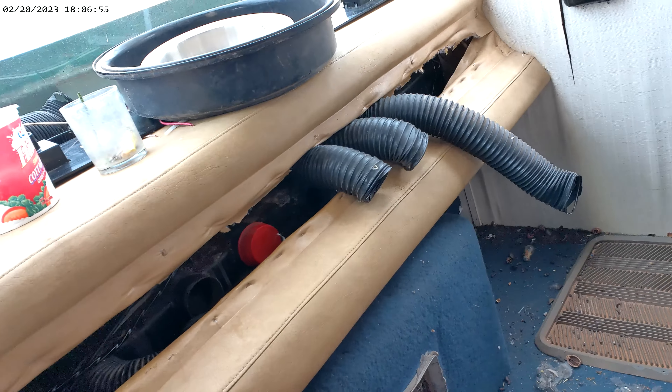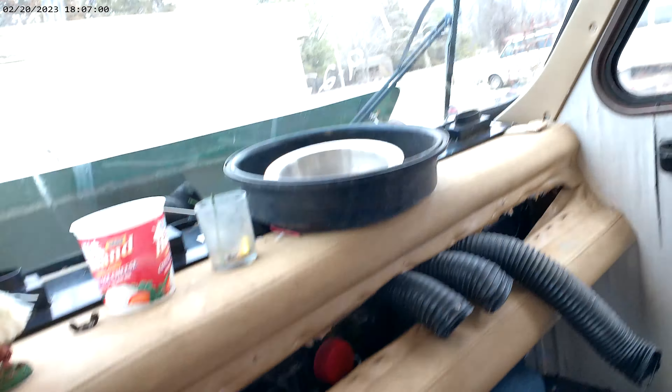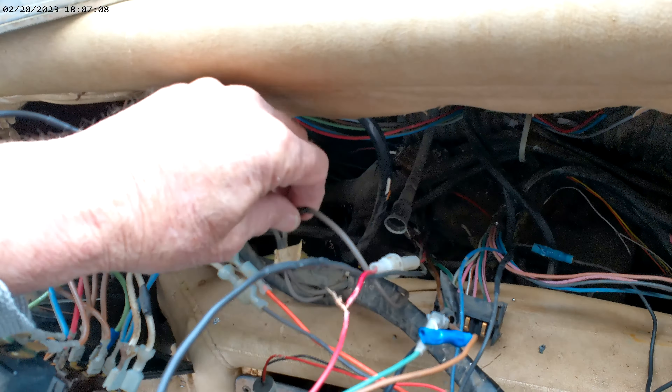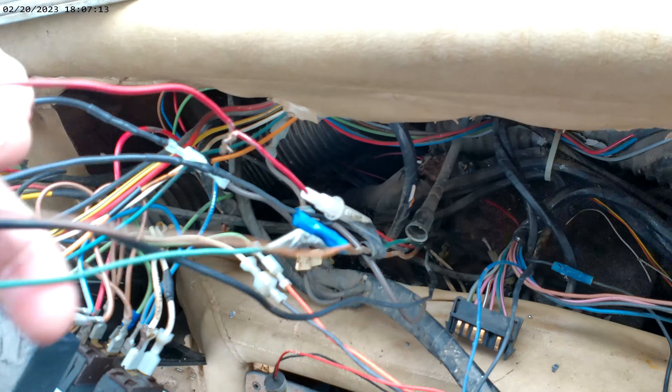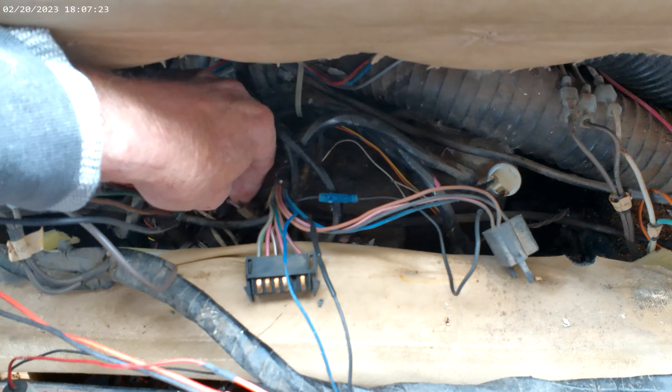If I had run this wire right here - that pretty one right there - it goes all the way out to the front of the truck. Right side wiper motor - that was the stop wiper motor there. We have repaired this wire and put an extension on the ground wire.